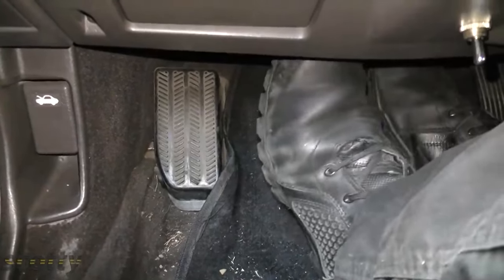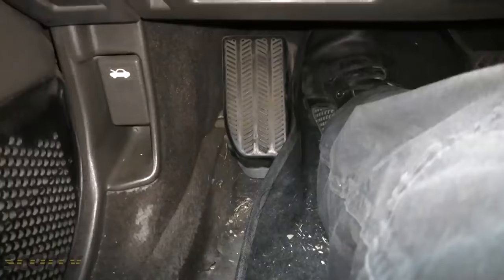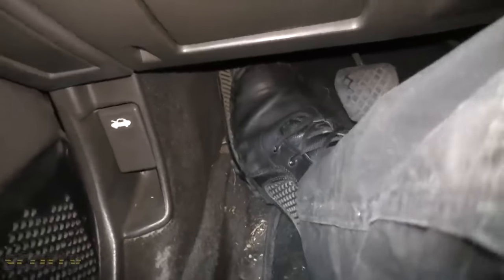Don't drive down the road riding the clutch with your foot on the pedal the whole time. Have your foot on the clutch to shift, then take it off and put your foot to the side when you're done. Do not drive with your foot resting on the clutch or you will wear it out. I had a customer years ago with a manual transmission BMW who kept wearing clutches out. When I rode with him I saw he had one foot on the clutch and one on the gas the whole time. He said his driving instructor told him to do that - I told him that instructor was wrong. Do not ride the clutch.